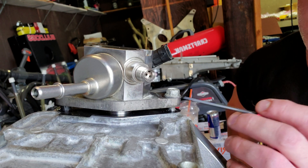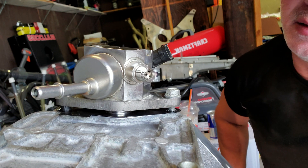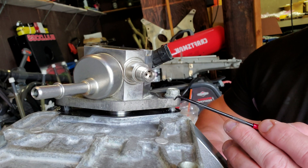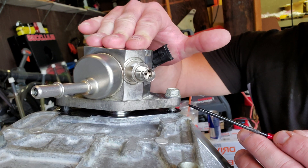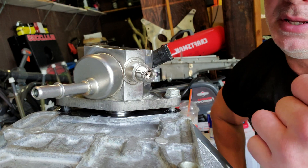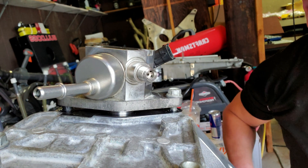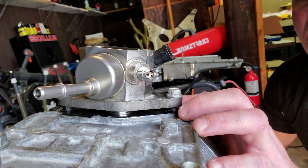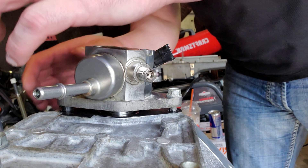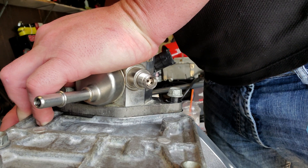The technique I'm using, since we have the engine out, is Andrew is going to actually turn the crank — turn the motor over several revolutions. And I'm going to push down with just some basic hand force to close the gap. When she rotates the crankshaft, if it bottoms out, it will lift this assembly up off of the front top engine cover. That's the way I'm going to do it and we'll see if we get any lift on that at all. I'm just using hand pressure.